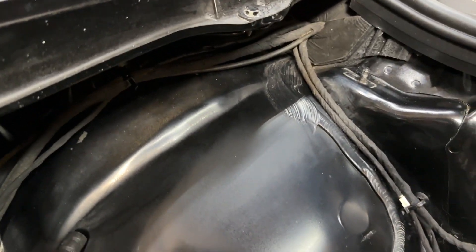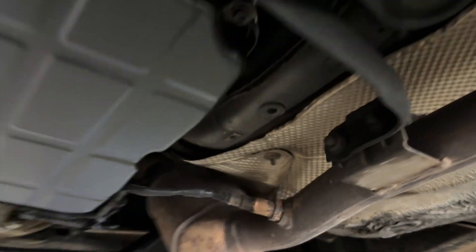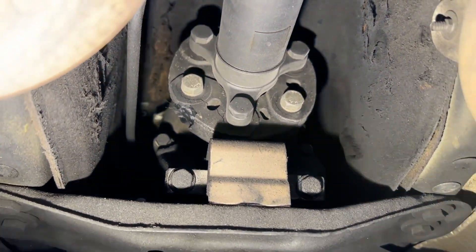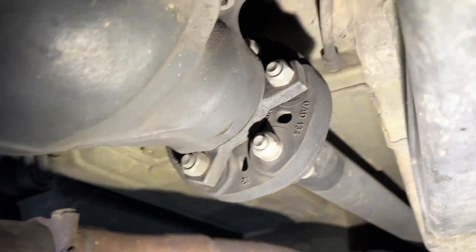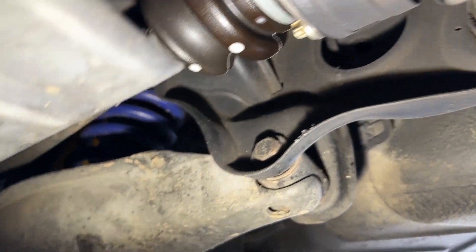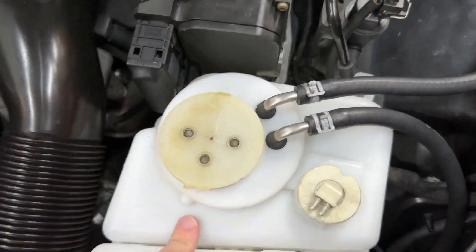Got the new washer tank in. Now doing the coolant, and while it's out we're wiping down the engine bay - stuff we can't normally access. It was actually really dirty here before. Got it all buttoned up, dressed up the belly covers, but I discovered something pretty bad: the flex disc is totally done. I'm going to pair that with the engine mounts and trans mounts and do it all at the same time. The diff looks okay, not leaking, and this flex disc looks good. Dressed the rubber boots with 303.